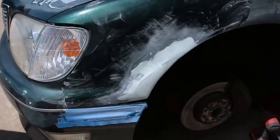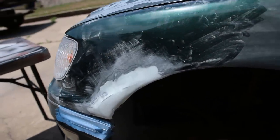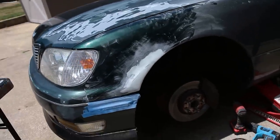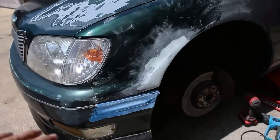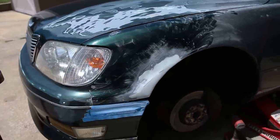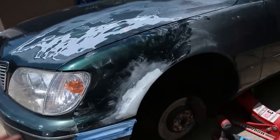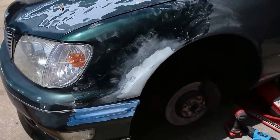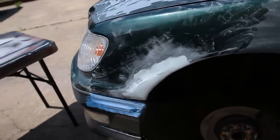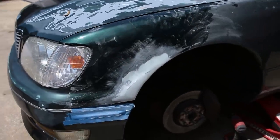So this is where we're at right now. Not super mad about it. It's not perfect by any means, but it's smooth — it actually looks like a fender. We just got to sand down a little bit more on the outside perimeter with 400 grit, get out all these heavy scratch marks so you can't see those under the wrap or paint. After that, we're going to clean it up and prime this section, then step back and see what it looks like. That is actually not bad for a super DIY budget fender repair, saving me $500.